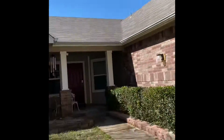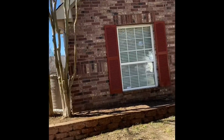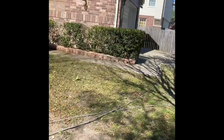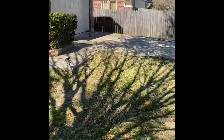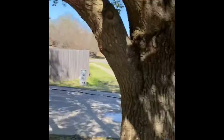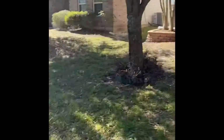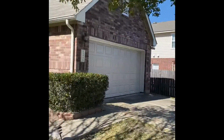Downstreamed everything. It's been sitting for about 3, 4, 5 minutes, somewhere around that range, and I went ahead and put the downstreaming stick into my water tank. I like to do that because instead of flushing it out after, I can just flush it out with water while I'm rinsing. So it saves me some time and it's a little bit more efficient. So I'm gonna go ahead and rinse this bad boy.